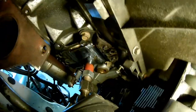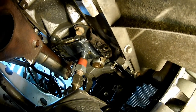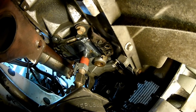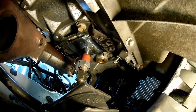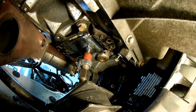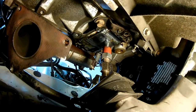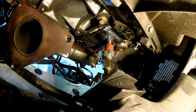I have a tack on there - it's super hard to do this. Normally you want three tacks. I'm going to try and gently get this thing out of there and tack the other couple before I final weld. Hopefully that works. MIG's coming Tuesday - worst case I can't do it, but I've got a pretty good tack on there so I think I should be okay.